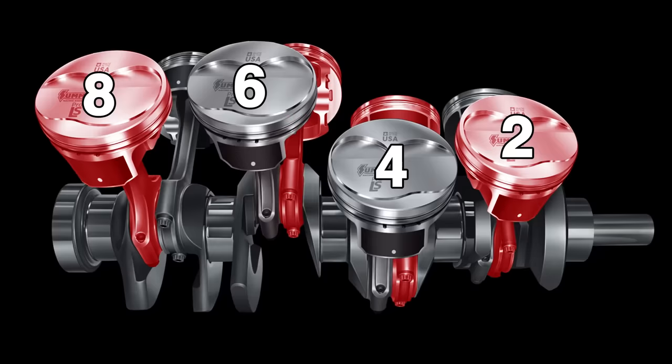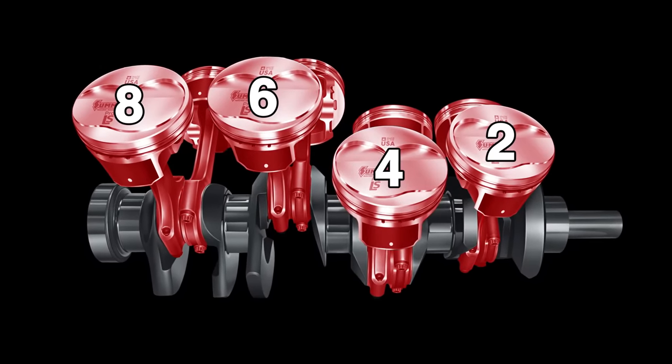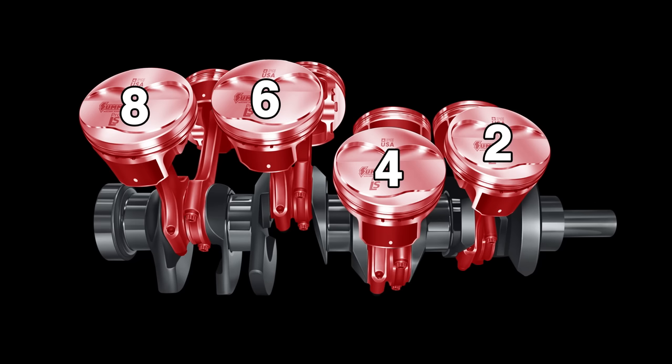The latest Gen 5 engines can shut down any of the eight cylinders in different sequences, which gives the vehicle the right amount of power for different conditions. As engine load increases, the computer sends a signal to the LOMA, the solenoids close, oil bleeds off the lifters, they return to normal operating condition, and your engine is running on eight cylinders again.